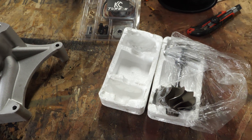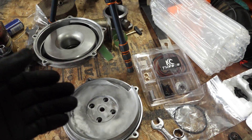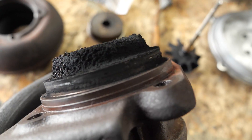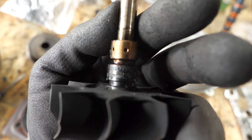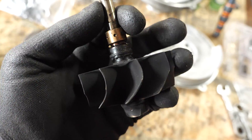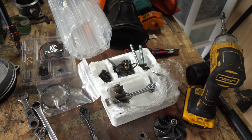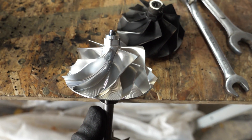The aftermath continues — not sure where you'll be able to pick up in the time lapse I did, but the amount of oil in here was not surprising. After pulling off the heat shield from the center section, the amount of soot in there was surprising. The exhaust wheel and some of its bearings are really good, but the seals are shot. The amount of oil coming through was probably a bit much, but everything else looks pretty good.